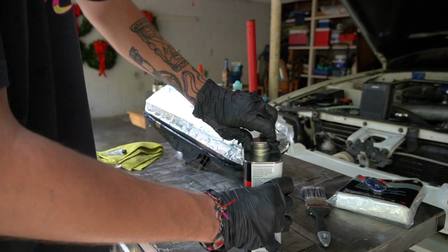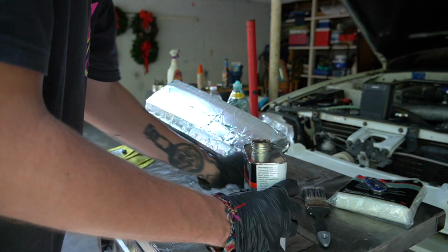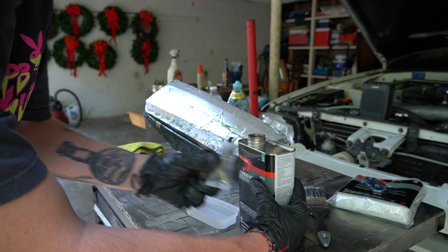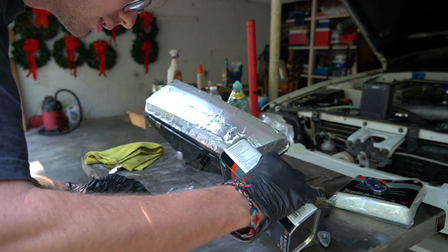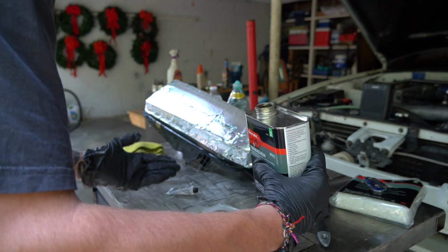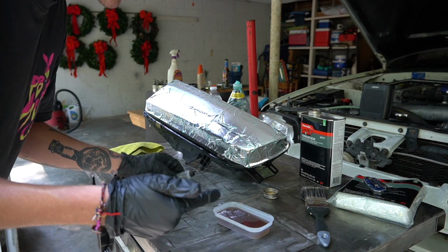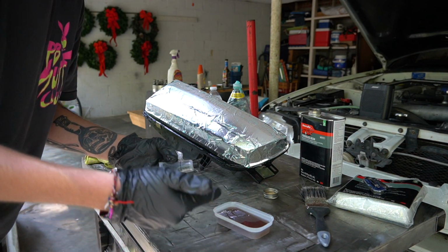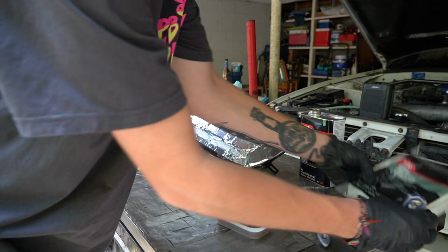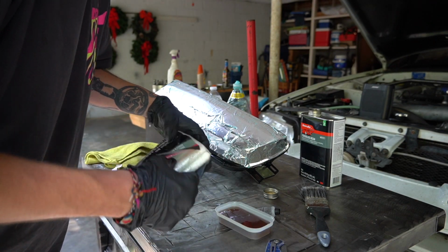Next, we're going to go ahead and mix our resin. I've never mixed resin. Long story short, quarter bottle of this, quarter bottle of this. So this stuff is potent. I'm gonna assume that's about a quarter bottle. Working time for this stuff is 8 to 12 minutes, so we don't have a whole lot of time. I'm gonna pre-cut some fiberglass strips here before I end up mixing the hardener. Otherwise, we might be screwed.